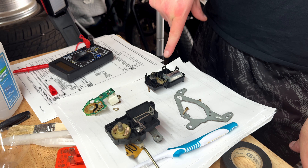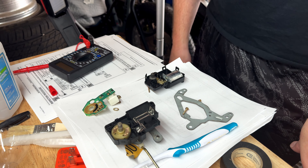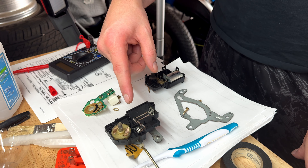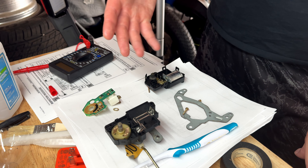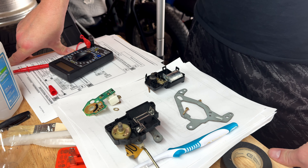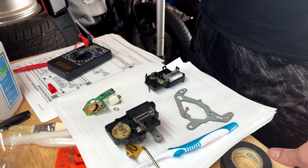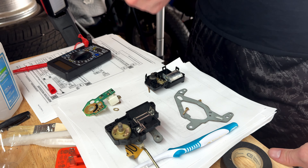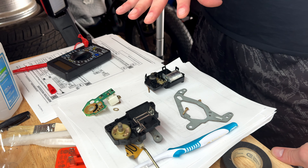This thing's barely hanging on by a thread so I'm going to get some super glue and try to get it in that void and put it back in so it doesn't fall off. I'm also going to run the thinnest bead ever — with a toothpick — of silicone here, because with the heat cycling of the heating and cooling system, this doesn't have any sealant from the factory; it just clamps together. My uncle told me to do just a small amount of sealant as cheap insurance, and if I ever need to go back in here I can just use a razor to cut it out.